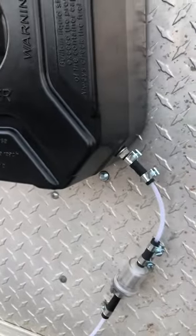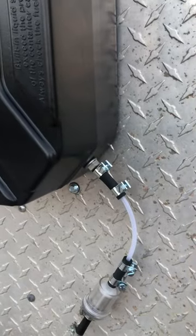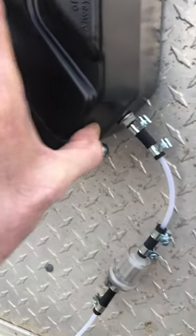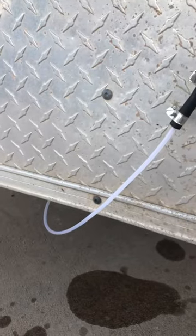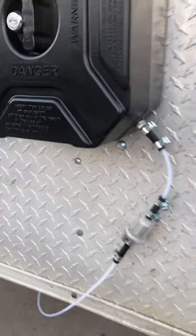It's so much nicer than the junk tank they come with. Because it's black, you won't get any UV problems, and it's super thick down here — you can barely even push it in. So tapping the fuel nipple in was no big deal, and it comes underneath where I have my fuel pump and stuff.